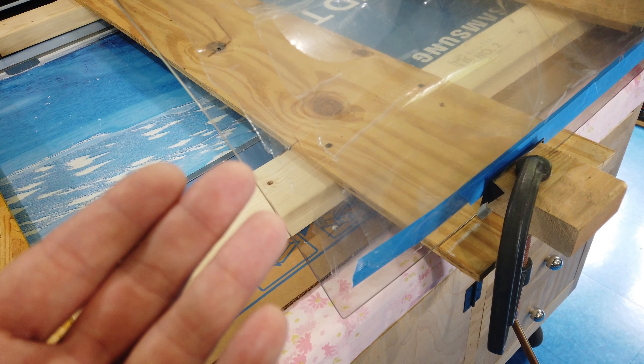I used the plexiglass bit - an eighth-inch - to drill the initial hole. Then I countersunk because the countersink pilot is eighth-inch. After the countersink was done, I went back and opened up the hole - it's 5/32nds, slightly bigger than what you'd usually use so the canopy has room to move. I'd personally like it a bit bigger than what Vans recommends, but I'm going with their spec. I used a unibit but the steps between weren't deep enough to get all the way through the plexiglass, so I went as far as I could from one direction and came from the other direction to clean out the hole.